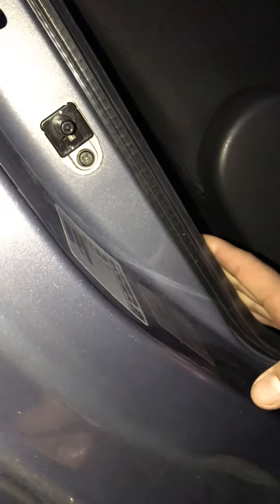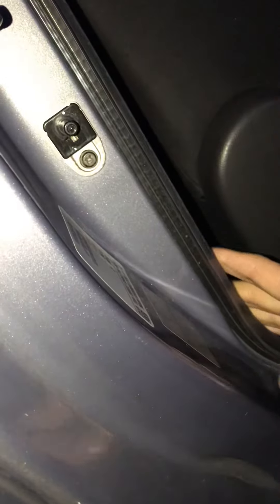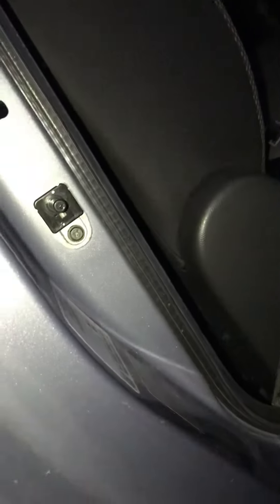The car we're working on today is a Nissan Micra, a 2010 plate. The problem, as you can see up there, is the light isn't working but the door is open. Just to prove the light does work, the camera will show you the light does power on. It's set to doors-only mode, however this switch is faulty.